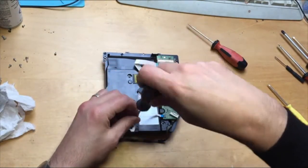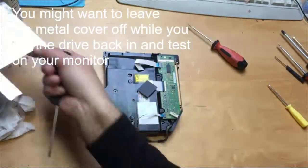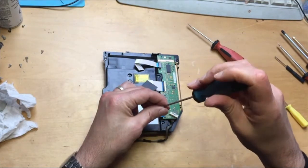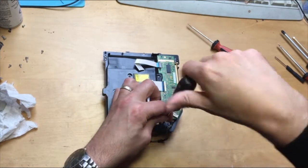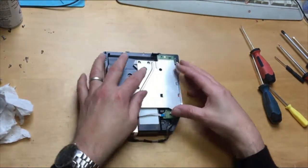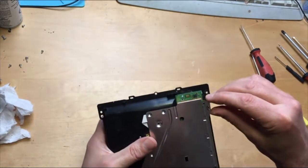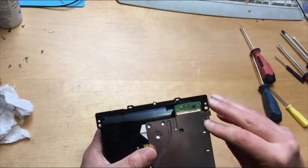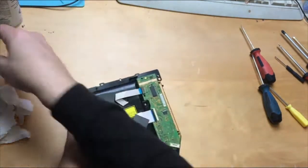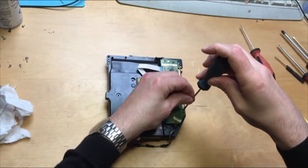First thing to do is to test the laser before you put it all back together. So what I would recommend is you can leave this metal cover off while you're testing it. It should be okay. So put the screws back in. And once the console has been tested, then you can get back into the console, put this back onto here like that. Right, screw goes in there, screw goes in there, screw goes in there. Okay, but just for testing it, you might want to put a screw in there just to hold the board down while you're testing it. Okay, so you could put one down here,